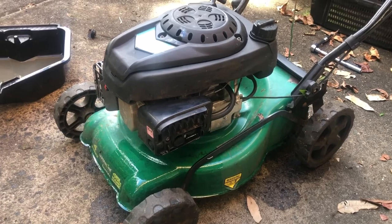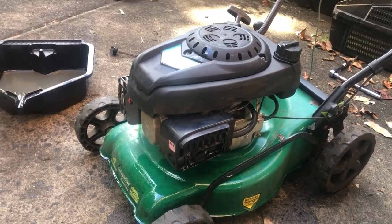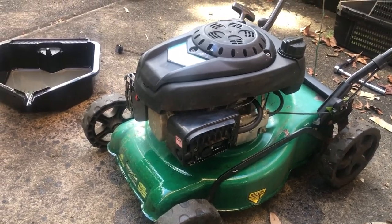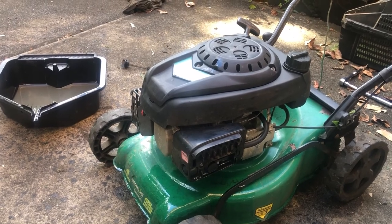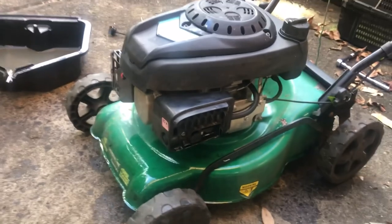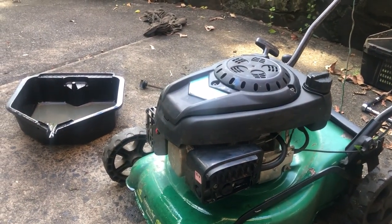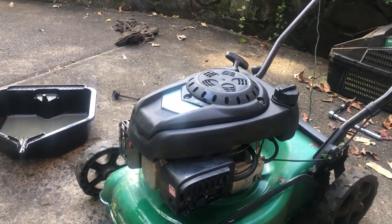Here's a good example of one problem that can crop up. It wasn't out of fuel - what's happened is the needle and seat in the carby have obviously got a little bit of rubbish pulled in and jammed, so that's all fuel dripping out of the carby because it won't shut off. Tomorrow's job will be to pull that carb down, but for now I've got to drain the rest of that fuel out of it.